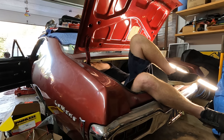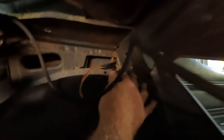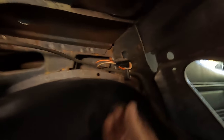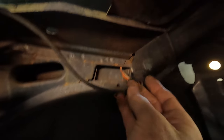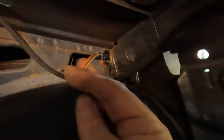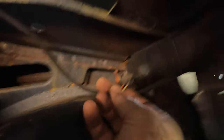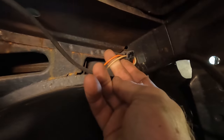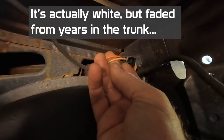Yep — orange and tan. Orange and yellow are going up to my dome light. There is a little clip right here that the harness was sitting down in. There's actually a plug right here — I can unplug this, take these wires off, use this plug to just plug into my existing dome light. So the orange and the yellow were the ground and the power for my dome light.